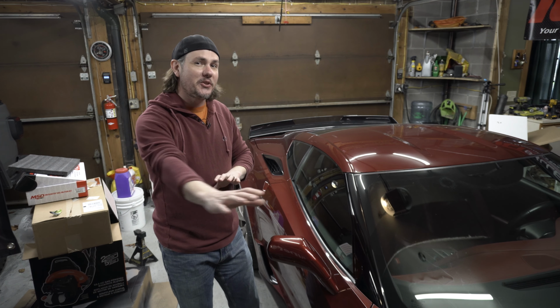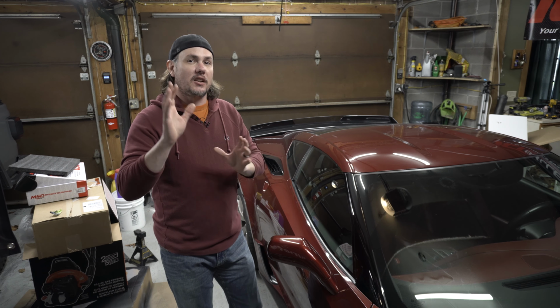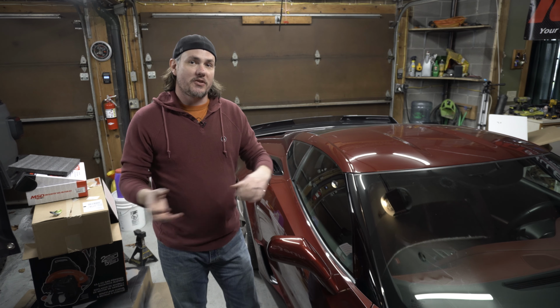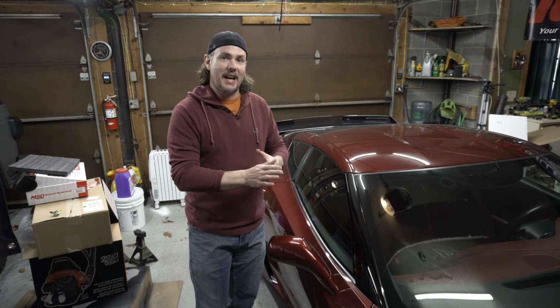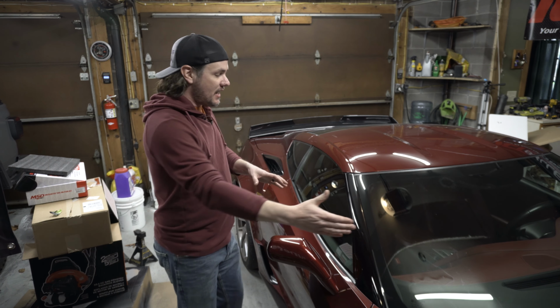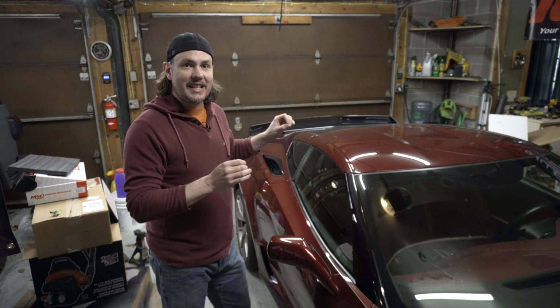In fact, I was able to get everything out with those in place, but getting the long tube headers back in place, that became the issue, and I had to remove those lines, or at least unbolt them from the engine pan, move them out of the way, set the headers up in there, and then I could bolt those back up. The rest of the exhaust going back, once you get the tray out of the way, is very straightforward and clear, easy to get to.